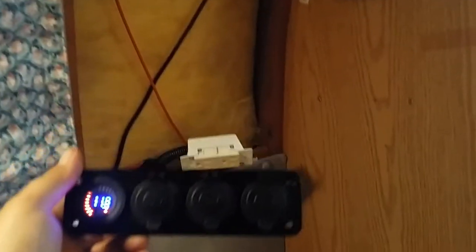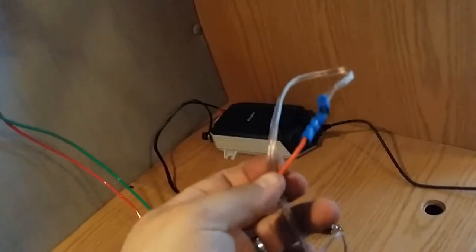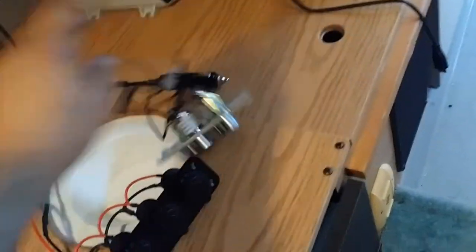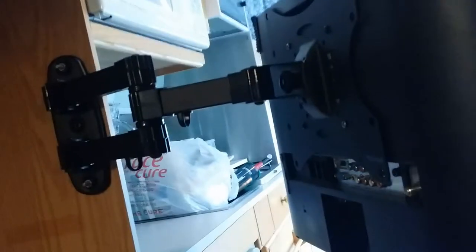I was running the Wi-Fi booster and had the inverter plugged in. It's an upgrade from the two old-school 12-volt cigarette lighter plugs that were in a J-box inside the cabinet. I had daisy-chained off those wires connected to a TV antenna booster, but I took the TV antenna booster out and upgraded everything. I want to be able to power the TV, the wireless, the phone and data signal booster, the MiFi jetpack, a docking station, and a laptop that might be charging. I might also be doing video editing, so it will pull some power. The antenna on the outside feeds into the WeBoost booster inside the RV.